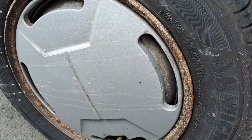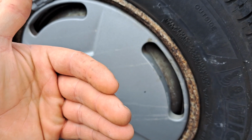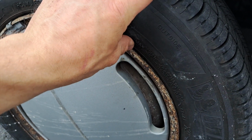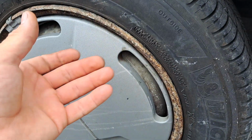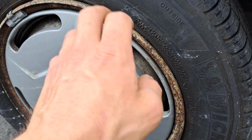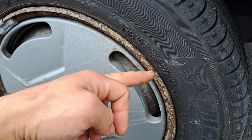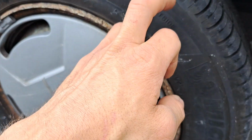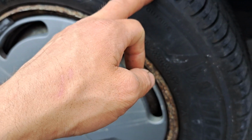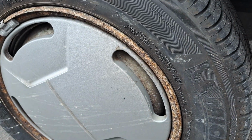Now, obviously, because a tyre can stay put on the floor, especially on these, because there's so much tyre on it, when we adjust it we've got to recheck every single time by moving the car and resetting it. Every time you adjust the mechanical side of it, you've got all this rubber that will flex around, so the tyre probably won't even move, but the middle of the wheel where the rim is, which is connected to the mechanical side, will move.